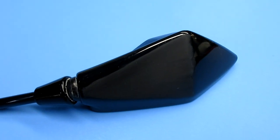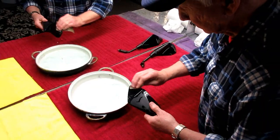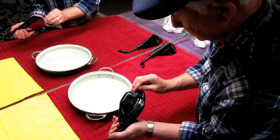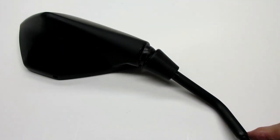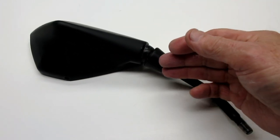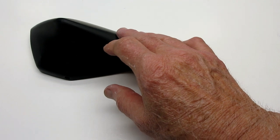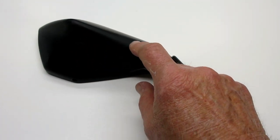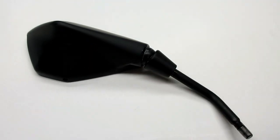I know this will buff up with the 8065 and it'll be absolutely beautiful when done. I don't even need a machine — this is a small enough part to do it all by hand. That is the best way to refresh any paint on anything. It does take a few minutes, but it's really not difficult. It's that old thing we all talk about — the labor of love. Once I've got the whole thing flat sanded, buffing it out is a relatively simple job. It wouldn't matter if you're doing a side cover, a headlight cover — any part, as long as there's enough clear on it. That's why I like to buff these parts by hand: a lot less chance I'll go through.